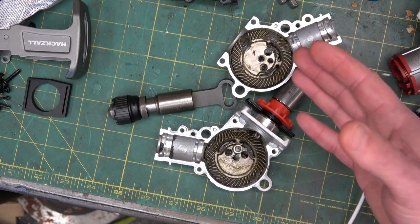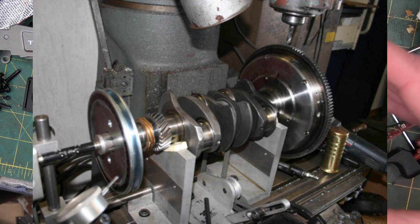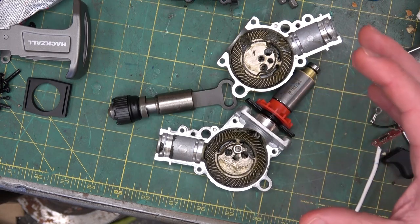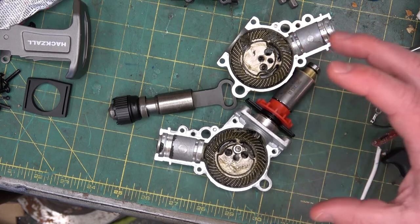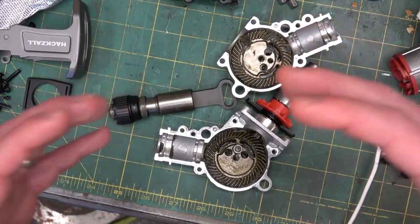We have torque inputs and so forth. We have a flywheel, which is a balanced weight that adds rotational inertia to the system so it smooths out the power impulses. Then on the crank itself, we have counterweights to offset the harmonic imbalance due to the piston choo-chining up and down. Then on the front we have a harmonic balancer — normally a rubber damping system — which limits the torsional impulses inherent in the crankshaft. Those three different systems are all for harmonic reduction.